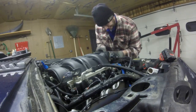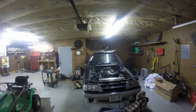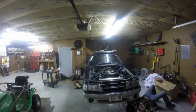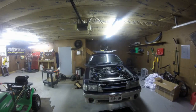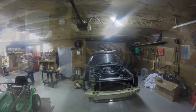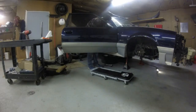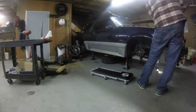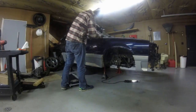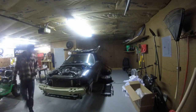I get the throttle body and air intake back on — that's pretty specific to this car. If you still have a five-liter in there it's probably a different story; you can grab onto those intakes, they're pretty stout on the old five-liters. Now we're starting to take off the front bumper — most of the stuff is 11-millimeter, there's a couple of 8-millimeter brackets. Disconnect the headlights and corner lights wiring and a couple bolts — pretty simple stuff. Then we can start on the fenders. The whole reason why I'm taking apart the whole front clip is that the strut tower and apron modifications are going to be pretty much impossible if you don't take the fenders off. Mostly 8-millimeter bolts. There's only one bolt in the door jamb and the rest comes out pretty quick.